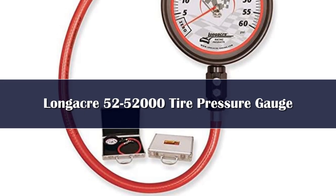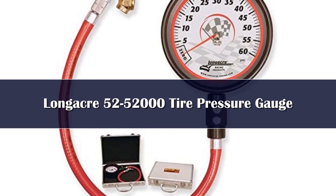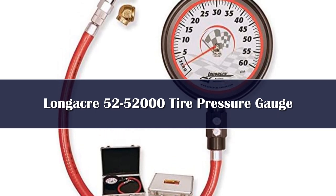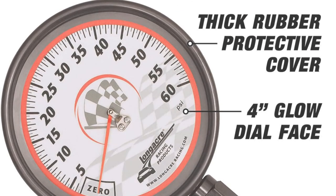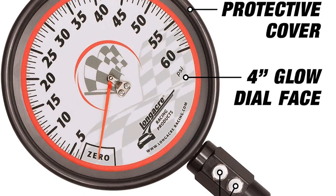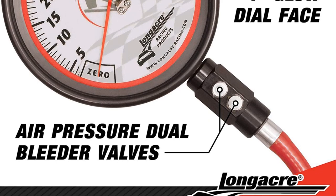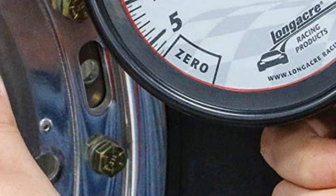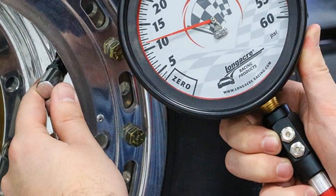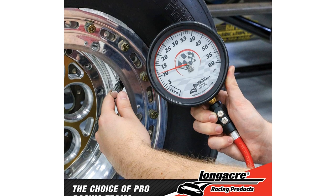Number 2. You aren't going to see a Long Acre in most garages or even tire shops, but if you need the most accurate and legible tire gauge this side of the aerospace industry, there aren't too many other choices. Where you will find them is in places that build and race cars. This massive USA-made gauge sports a 4.5-inch face and is marked in 0.5 psi increments from 0–60, which makes sense when you consider its lab-quality 0.5% / 0.25 psi accuracy for the entire range of the gauge, or ASME B40.1 grade 2A.